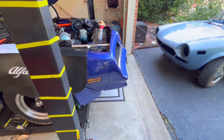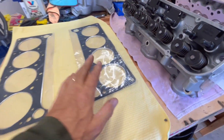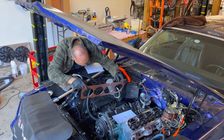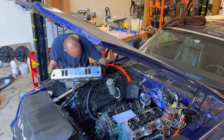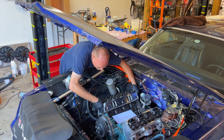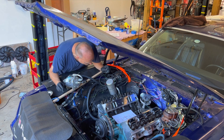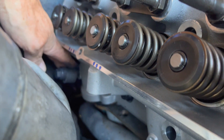Grease the bolts, wheel the cart over by the car, grab a head gasket, spray it two coats, apply the head gasket, grab the head, drop it on the block. Start with the short bolts, throw them all in finger tight. There's the problem stud.